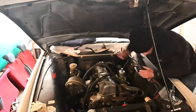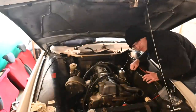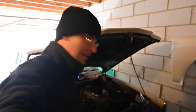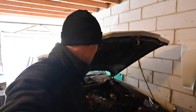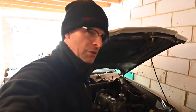I also need to bolt the engine mounts back to the car because I unbolted them first. I wish I'd lined them up when the engine was still on the jack. It's not a 100% perfect solution — but is it ever on this channel? The bolts aren't long enough, I need to get some longer bolts, and the one on this side isn't quite lining up properly. What I really need to do is get it home where I've got access to more tools and can actually do stuff better, rather than being stuck working around car seats. As this car is technically MOT exempt, I could in fact drive it legally around the corner and finish it there.